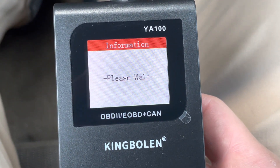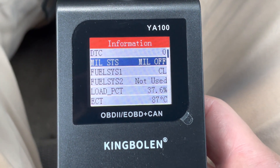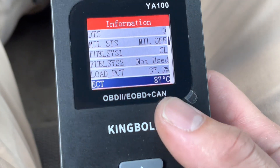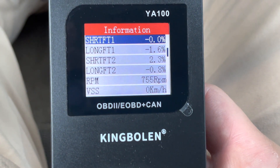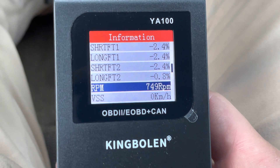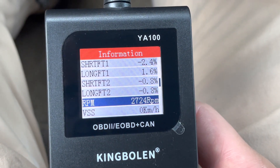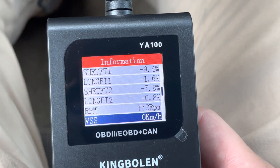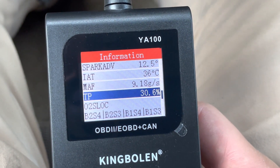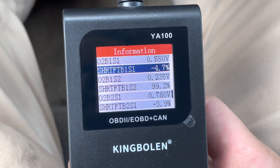Let's go to Live Data — and this is where it's going to be extremely helpful. For the price point, it's pretty amazing. No trouble codes, check engine light is off. Fuel system is closed because the car is at idle — 38%. You can see it shows Celsius; couldn't get Fahrenheit but it doesn't matter at this price point — 87 Celsius. It's got short-term and long-term fuel trim, which is excellent for a scanner at this price. RPMs — I'll give it a little rev — very responsive. That's the spark advance, intake air temp, MAF, throttle position sensor, and then you have the O2 sensors. It's got all that monitoring in there.